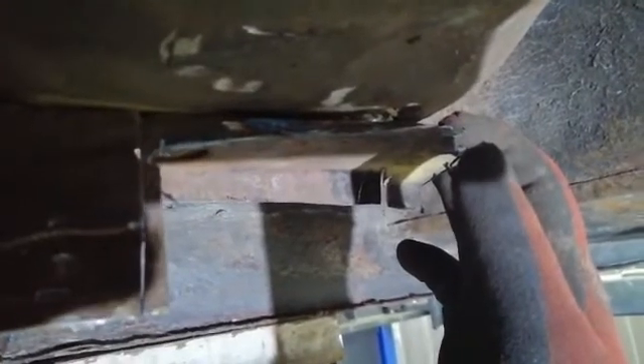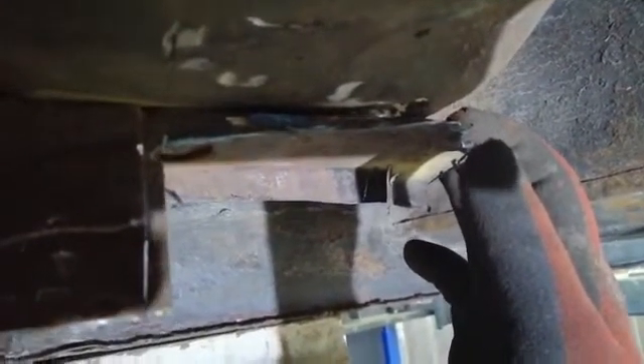I'm back now. You'll also notice that it's still attached to the seat base. On inspection of the inside of the car looking down, I couldn't see any weld marks to show that the two were welded, but there's a weld at this point and there's a weld on the other side as well. So I'm just getting through that with a cutting disc now, gently, to try not to damage the seat base, and I may end up just grinding it off with an angle grinder so I don't damage the base.